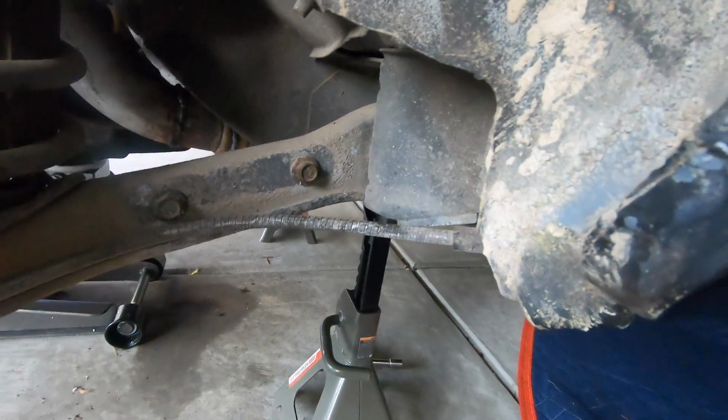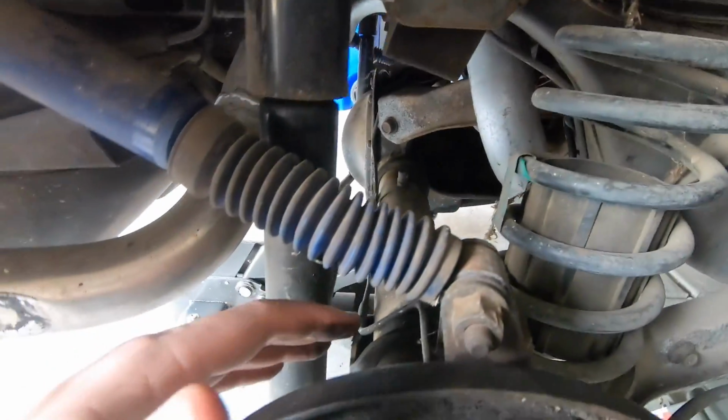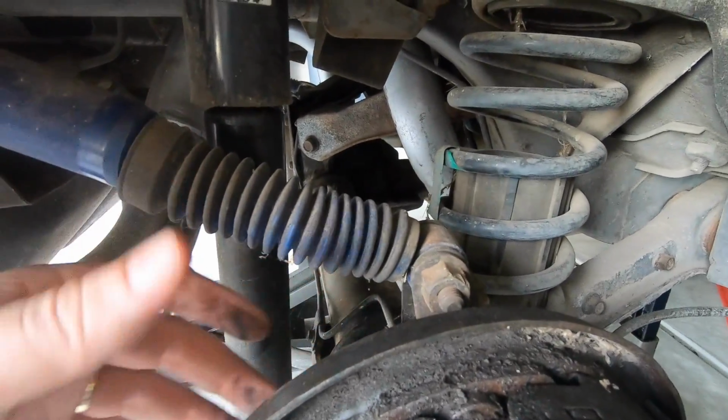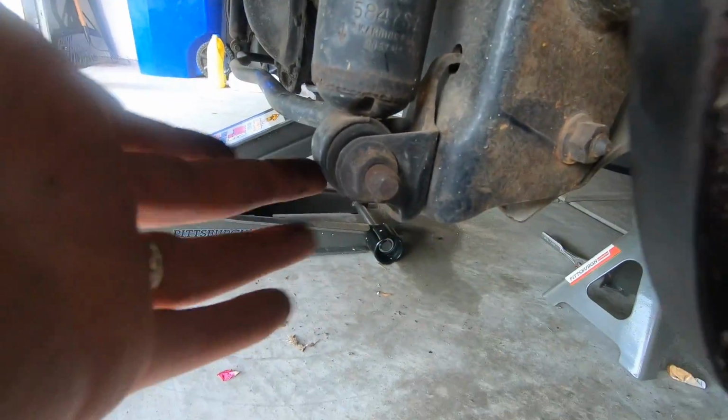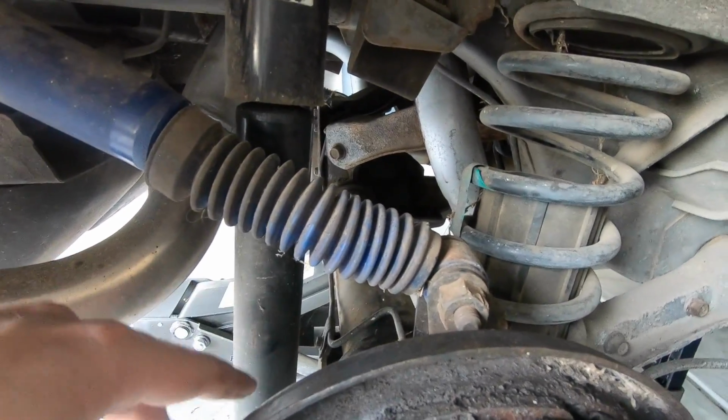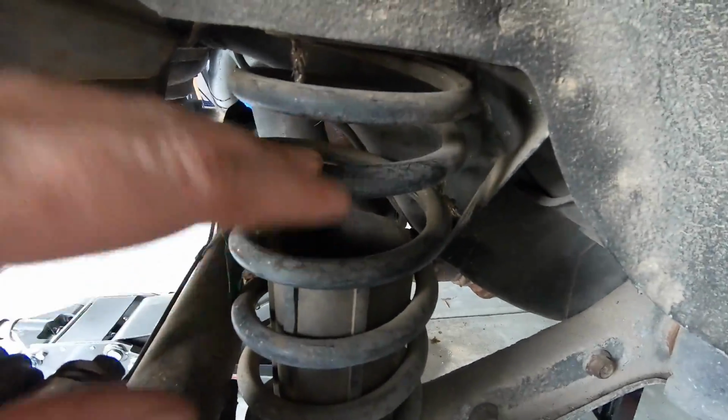I don't know if I'm gonna actually finish this video, get the rear end dropped in this video. It might be the next video, I'm not sure, but here's the other steps I got left. Once that is done, I gotta get the brake lines off, which are running right behind there, and you can disconnect those from the back, I believe. Of course, the shocks, got to take the shocks out. Then the quad shocks as well. Then I should be able to lower the rear end down a little bit to get the springs out.